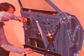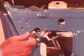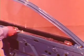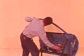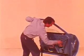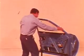Next, tighten the glass track screws. Tighten the glass to plate and channel assembly attaching nuts. Move the trim support and stabilizer assembly in until the stabilizers contact the glass and tighten the bolts. And that about covers it for this session. Be sure to read the reference book for additional information, especially the coverage on the new heated backlight for intermediate station wagons.